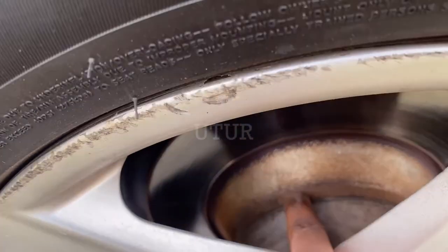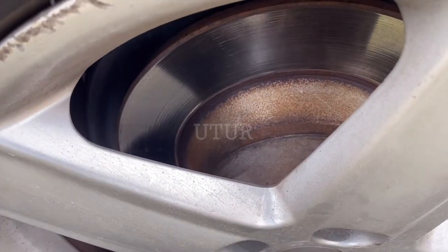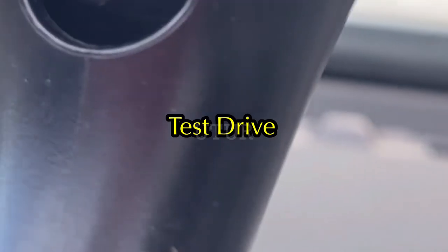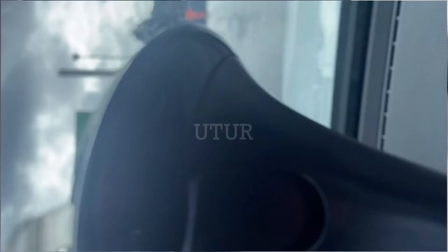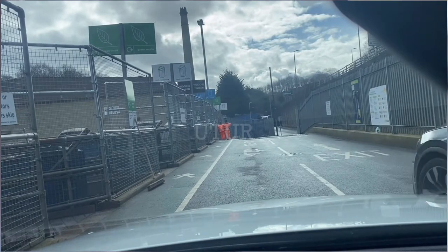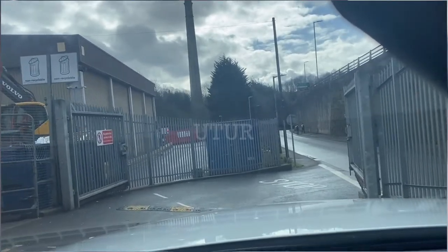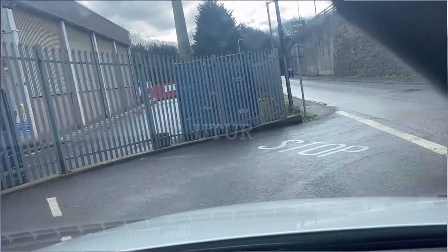In this case it was coming from the wheels. When I was partly hitting on the brakes you would hear the noise in a jiffy whilst accelerating on a test drive. This squealing noise becomes more apparent when I lightly hit on the brakes, but when I come to a full stop I get more of a grinding noise on the wheels. Both noises during acceleration or when coming to a full stop are intermittent — it's a bit of a hit or miss, they come and they go.